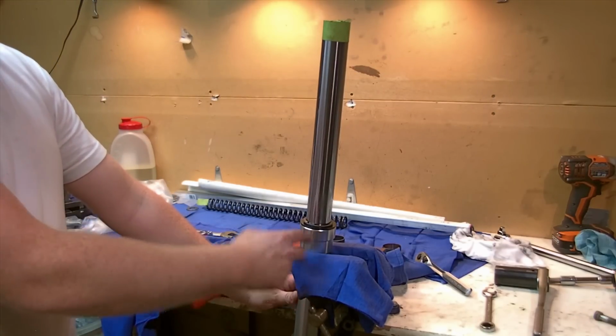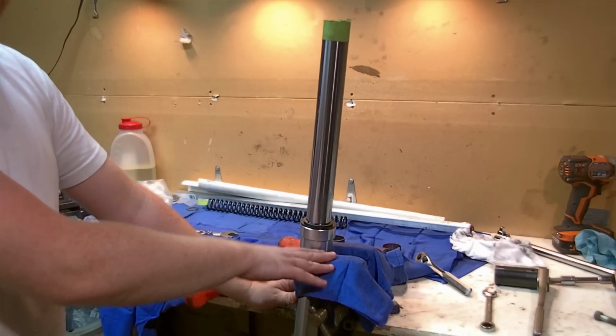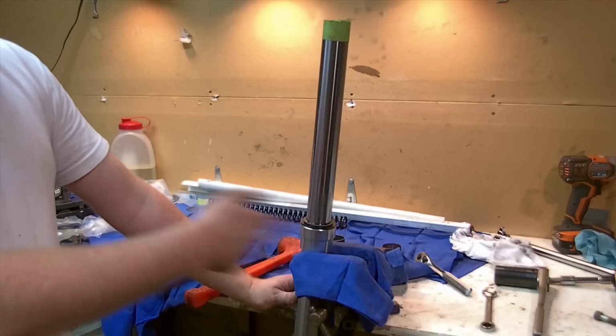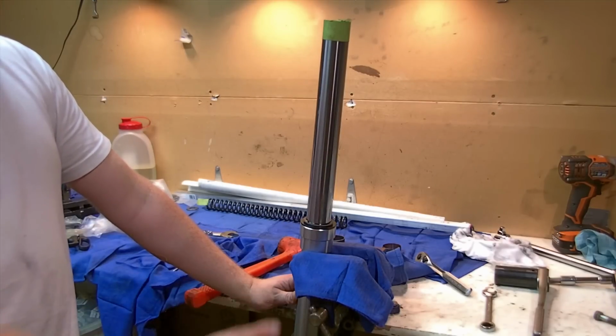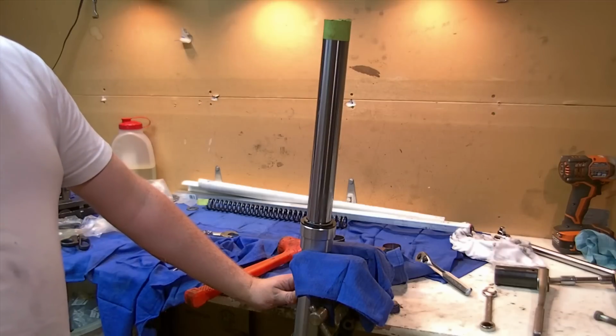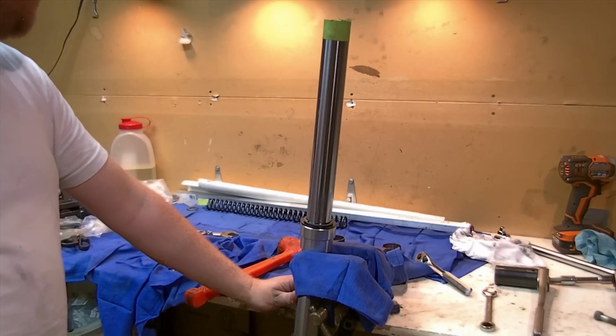It's very close because there's probably always going to be some residual fluid in your forks that you couldn't quite clean out. So yes, you can guarantee that you put in, for example, 15 ounces per leg, but one leg might have had a little more residual in there, so technically it's slightly higher. Would that be okay? Most likely yes. In street riding it would be fine.